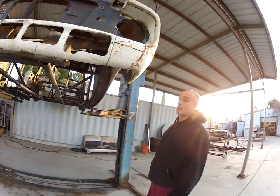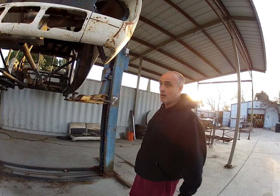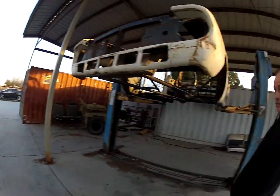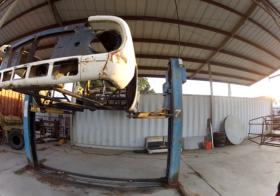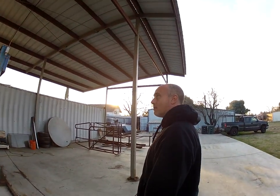That's actually the best way to make power. The bigger the piston you can put in a motor is the best way to make power. If you're dealing with just a normally aspirated motor, surface area on a piston is what you're looking for. Stroke is secondary. But you do want a long rod. If you get a long rod in a motor, you'll survive to a lot of RPM.